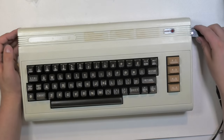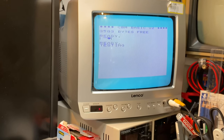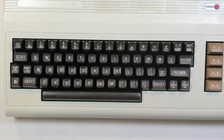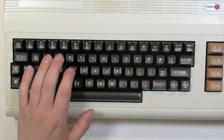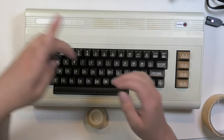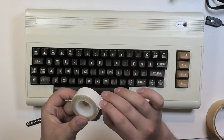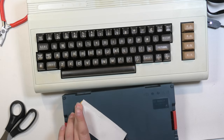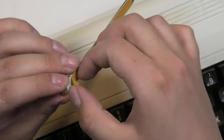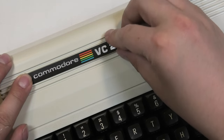I put back the power LED, reconnected it to the motherboard, and closed the lid. A quick test — no smoke expected — and thank god, it still works. You never know with my soldering skills. The keys also register better now. The letters also look much whiter now. I need to reapply the badge. I have two kinds of double-sided tape, but this one is a bit too thick, so I used carpet tape instead. I sliced a small piece off, put it on the badge, and reapplied it to the case. Finally it's complete again.